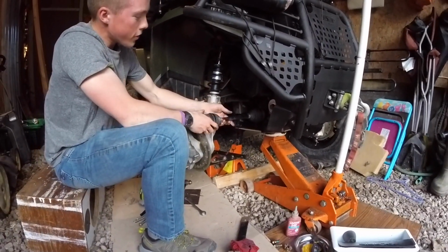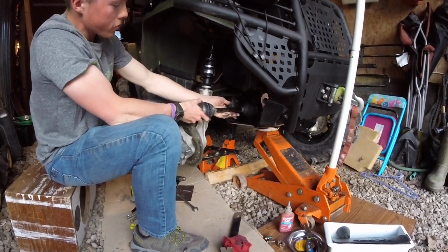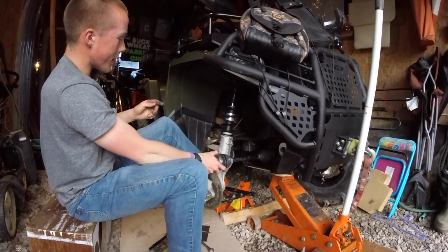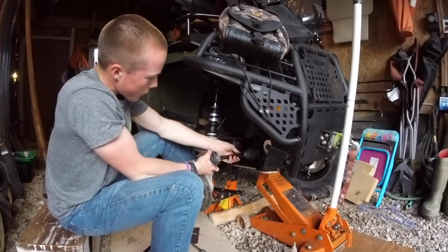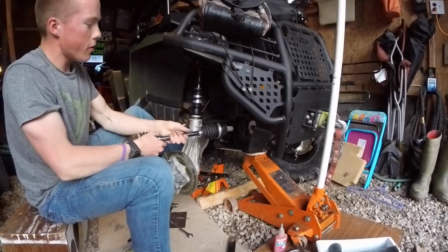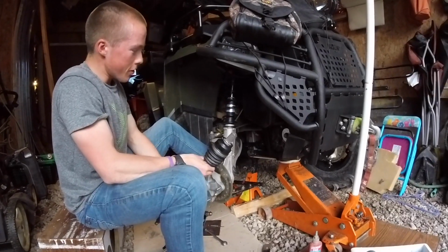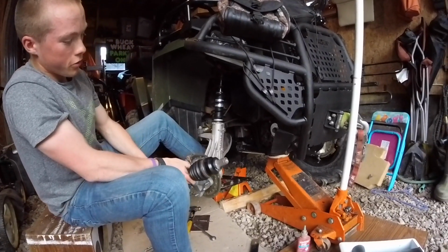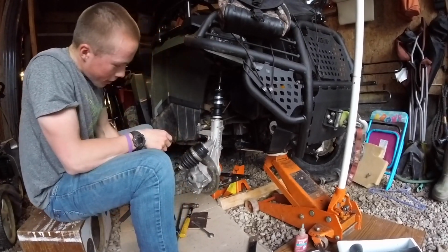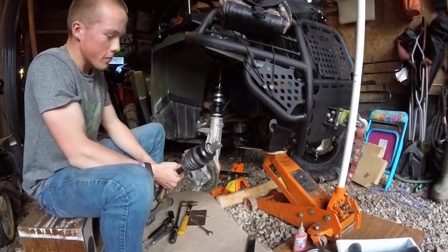So then after that, you can just get it straight and hold on to the axle shaft when you're doing it. And put your foot against your quad so you don't pull your quad off the jack. And then you just give it a snap. It is easier because we've already took it off, but the penetrating oil should help, but it might take a couple to get it off. Yeah, we had to really pull on it. It didn't want to come easy.